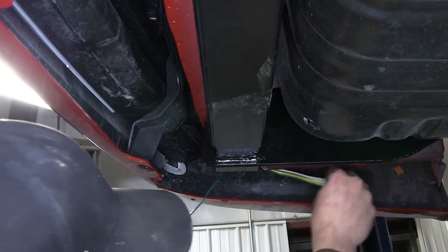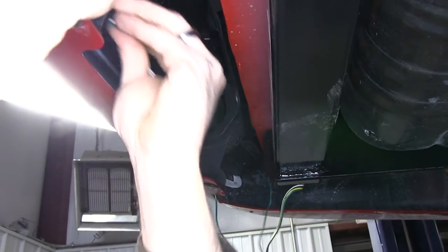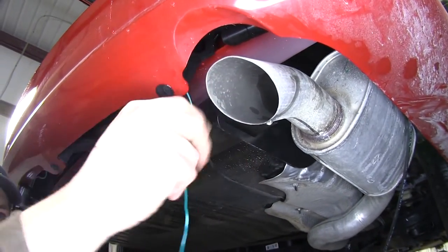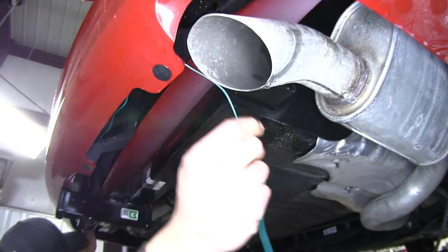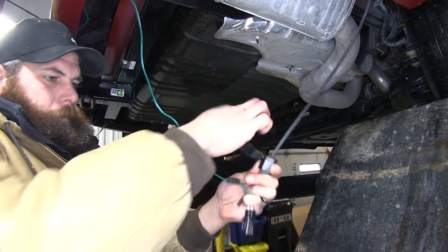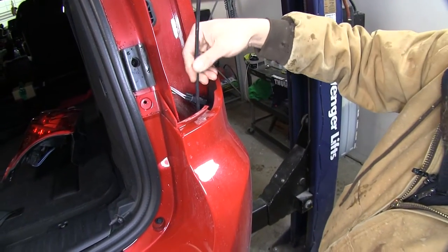There's a nice area right in here behind these bumper supports that would really help hold this up out of the way. We want to avoid any moving objects, any hot objects like our exhaust — we want to make sure the wire gets really well up and over the top of that. Then once we have it over here, let's connect it onto our pull wire and pull it up towards the top of the car. We'll free up the end of our pull and bring our wires on up through.